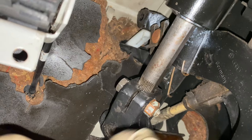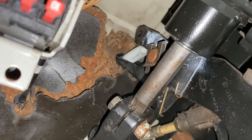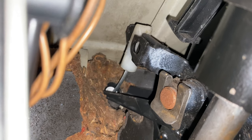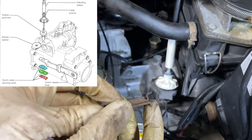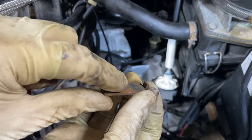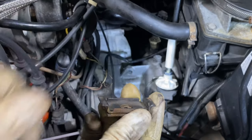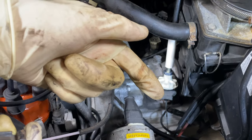Underneath the vehicle on the driver's side you can see the clutch cable — slip it in and then into the bracket it needs to go into. You just need to pull out on the clutch cable a little bit and hook it into that bracket on top of the clutch lever. It just takes a little bit of wiggling. The diagram shows how these cable retaining brackets work. This one is on the bottom — make sure the concave end is facing up. Then on top of that you lay this piece, and on top of that is the rubber piece. My rubber piece I didn't have a replacement for, so it's still down there on my transmission lever.